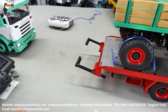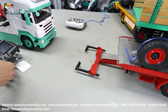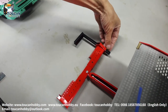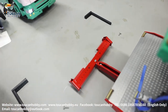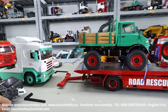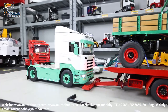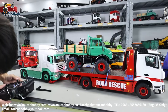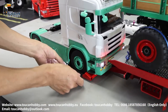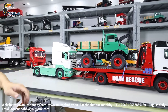This tail bar is first reaching out — also hydraulic. Put it down a little bit. This one is with a screw — you can turn it and unlock it, take out the bar, and drive it to meet the tires. Align it, then put it down. Almost meet the ground. Continue driving — not touching the chassis. Already reached the tire. Put this inside, secure it, find the hole, position it, lock it. Left side also secured. The tire is fixed. Then rise it — this is enough, then we can go.